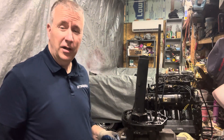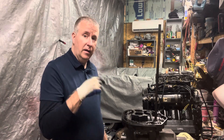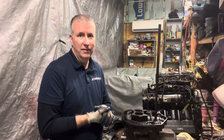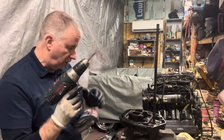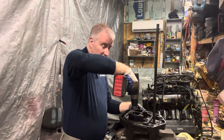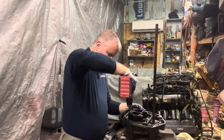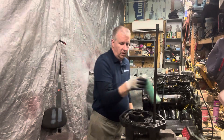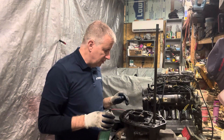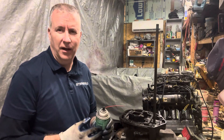I'm going to juice up these screws. Actually, you know what I'm going to do? I'm going to clean these out first — run a tap through these to make sure they're nice and clean. Then I'm going to clean it out with brake cleaner and put Loctite in there. I'm not going to use the red Loctite — although this will probably never be apart again — I'm going to use the blue Loctite because I like that better. Got my quarter-twenty tap in my drill. You have to be careful doing this; if it starts to go wrong, you have to stop. Or you can take forever and do it by hand. But if you hold it straight enough, you can get it done this way. All the threads are clean. Now I'm going to spray these holes out with brake cleaner — I'm not worried about over-cleaning this. There's no gasket stuck to it because we heated the crap out of it. Get it dry inside there so there's no oil so that the Loctite can hold on those bolts. Also, spray up the bolts a little bit — just the threads. Then we'll get them in here. We're all lined up now, so we just need to tighten it down.